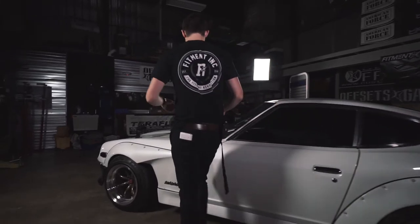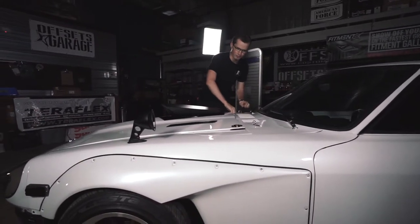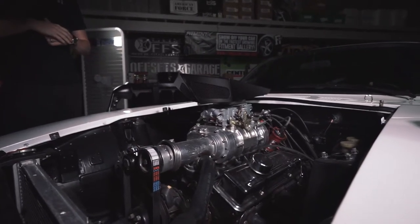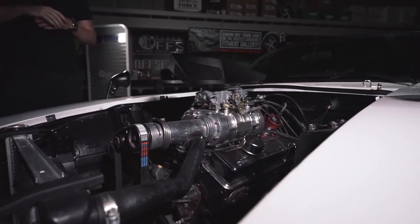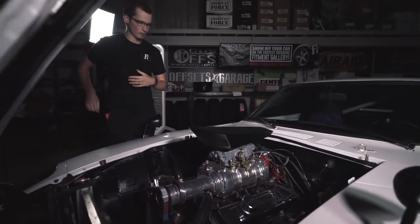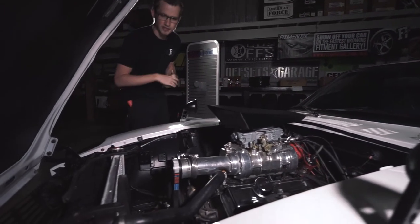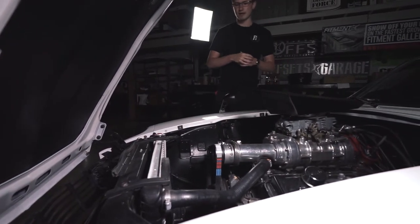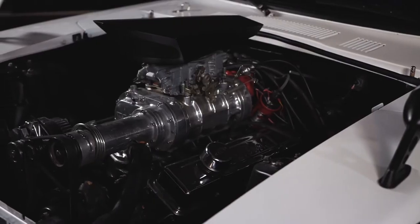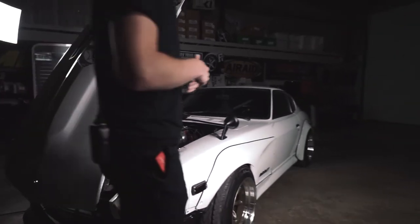Taking a look at the engine bay — not always easy to get to because of the hood pins — you can see how the 355 sits in there. There is a ton of space in these 280Zs; the 240 and 260Zs are notorious for engine swaps. RB25, RB26, and 1JZs are very common, and V8s are extremely common too — the LS3 being the most popular swap. However, we wanted to give it an old school cool look, so we went with an old school 355, or 350 bored out slightly. There's still about six inches of clearance in the front, which is what makes these cars so popular for engine swaps. It's paired with a T56 six-speed transmission out of a Dodge Viper to get that sixth gear for cruising and, of course, lots of fun in the first few gears. There are also a couple extra goodies on the car to make it go a little quicker.